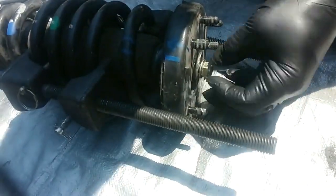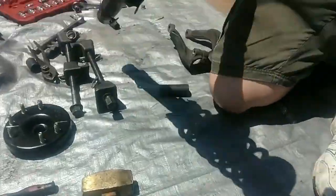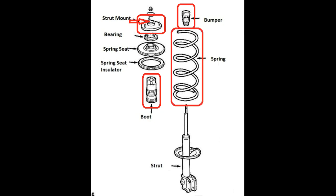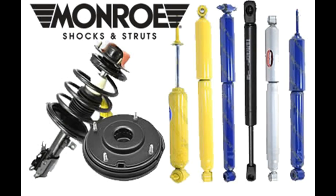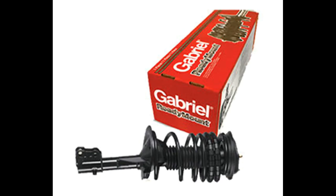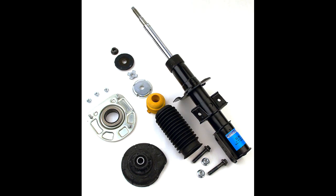The things that can wear out in the strut are: the strut stem bumper which protects the stem from over-compression; the strut mount rubber vibration dampener which when weakened causes rattling noise; the strut bellows or boot which protects the stem from dirt and moisture; and a weak strut spring that won't keep proper ride height. If one or more components need replacing, you may be better off buying a complete strut — also called a quick strut — with all new components. Companies like Monroe, Moog, Gabriel, KYB, and Sachs come close to or exceed the quality of original factory struts and come with a decent warranty.